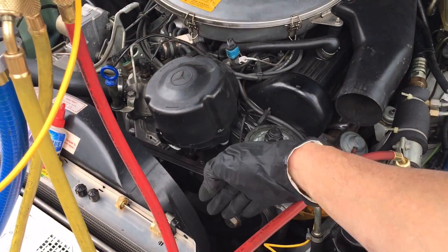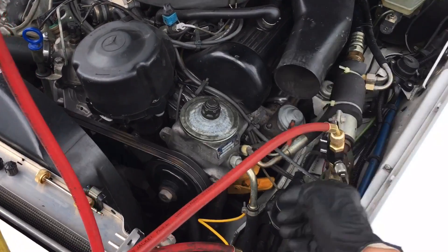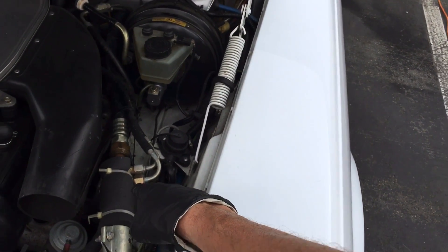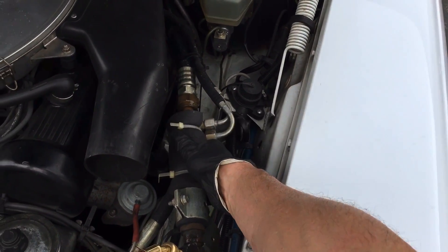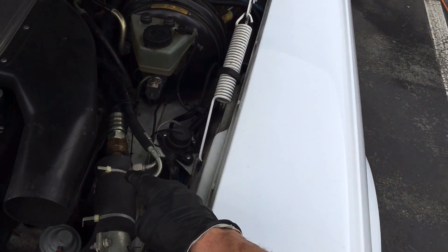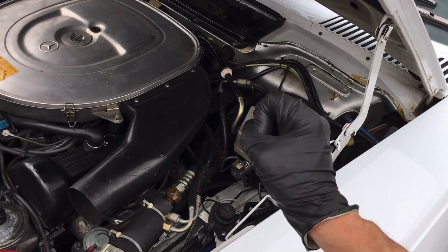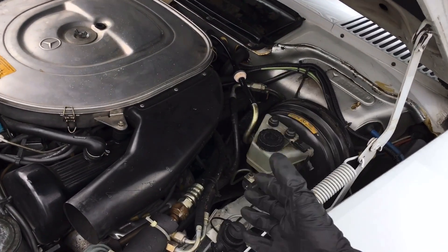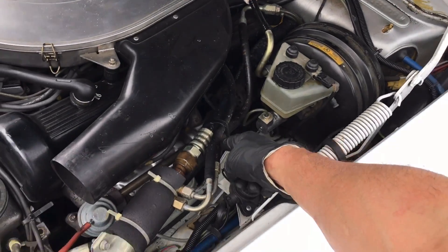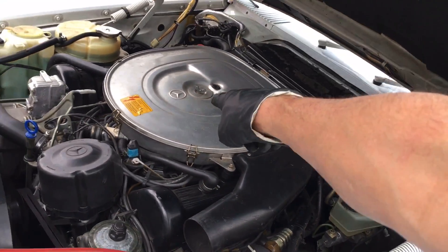Before the radiator heated up, with hot coolant air and condenser air going over there, it was measuring 33 degrees at the suction line. We also have a fuel line cooler — a heat exchanger right here that cools the gas from the fuel line, adding heat to the refrigerant. To stop pinging and vapor lock, one of the things Mercedes did was to chill down the gasoline by running it through a heat exchanger using the refrigerant, then feed it to the engine.